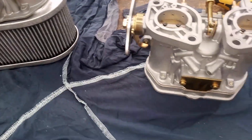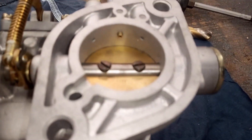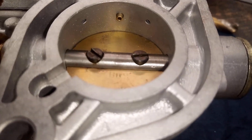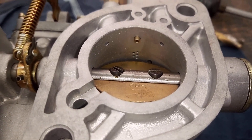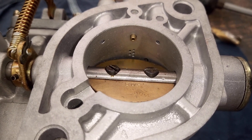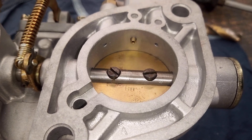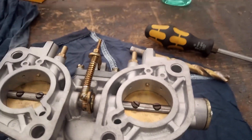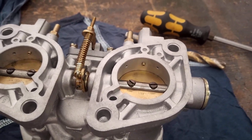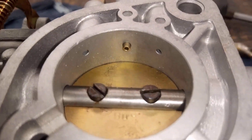As far as the flat spot goes, let me show you what I think is my flat spot. Inside the Weber now — if I open up you can see five progression holes. Five in the 36 IDF. The 40 IDF is four. The 48 IDF that I've got also has four. And the MP44 also has four. So four or five doesn't make much difference.